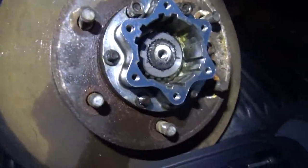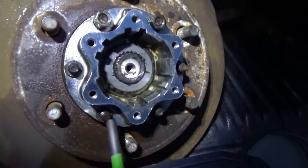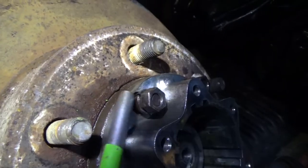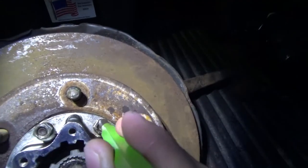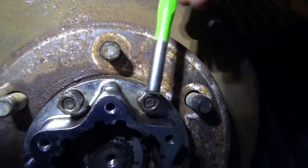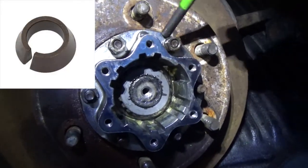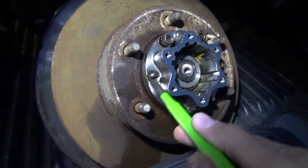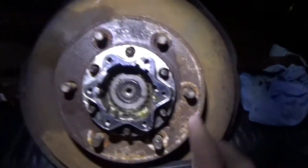We are finally making some progress. I've been struggling here for a bit. I got the chisel set, hit the PB Blaster on the six cone washers I showed you earlier. This is the cone washer right here. I was doing it wrong — I was trying to hit it like into the hub. Actually you want to hit it sideways and wiggle out the cone washer. I'm new to this, I didn't know what a cone washer was. It's like seated in this cavity and you hit it from the side and it wiggles out. We got all those cone washers out and this hub simply comes off.